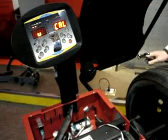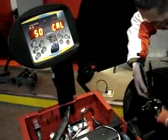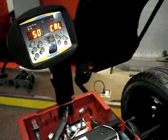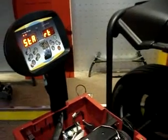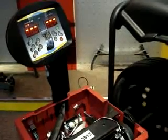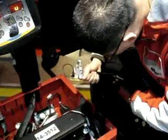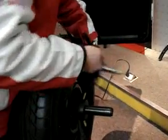So now we move the wheel, look for the symbol of 50, and we'll put 50 grams on the top. Remember, just a few minutes ago, when we added 50 grams on the inner side and gave a spin, there was an error 026. But this time, after we check the signal of the pickup A sensors, there is no error. Now I'm going to remove this one and check this part, at 50 grams on the outer side, perfect. Continue lowering the wheel guard.